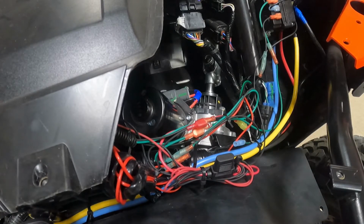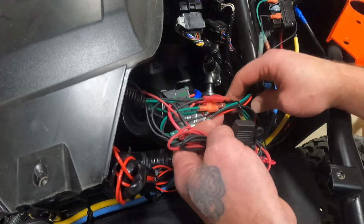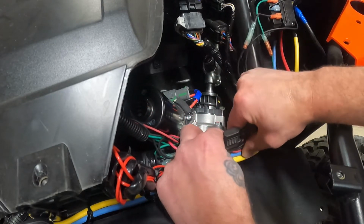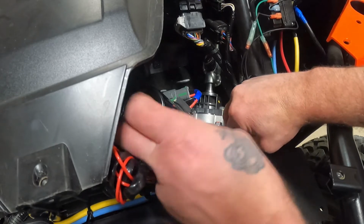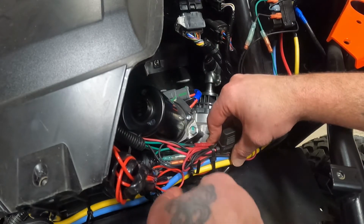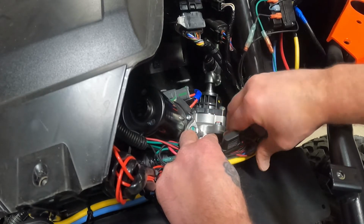So here is a close-up on what the wiring looks like now. Everything should be nice and insulated underneath the hood here. Got the wiring connections together. I have the inline fuse accessible. Now I'm going to secure this just like that. It should be out of the way of everything. Should be nice and clean. There's plenty of slack on the connections, as best as I can tell. The zip ties are cheap, electrical harnesses are not, so yeah, I'll zip tie the hell out of this.